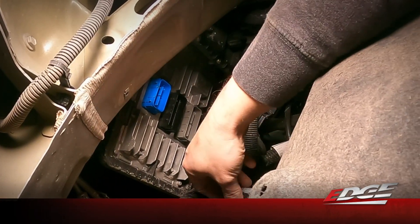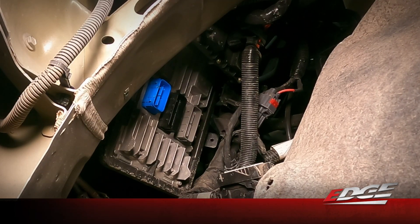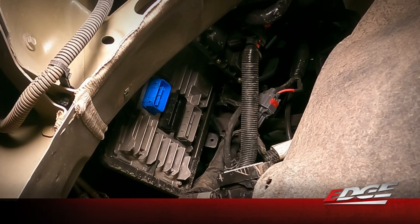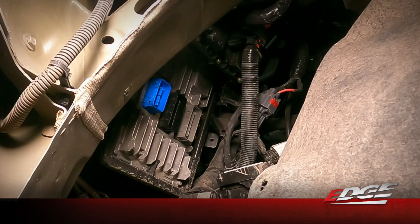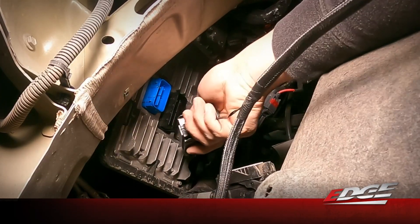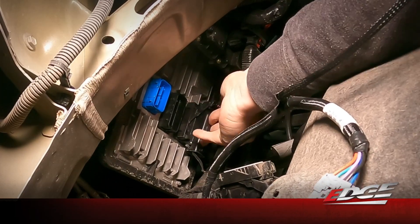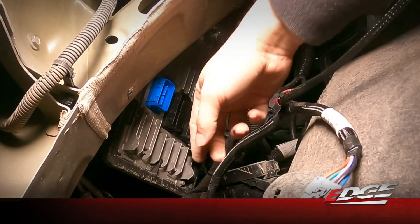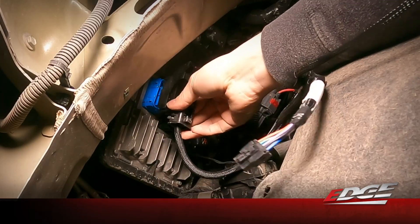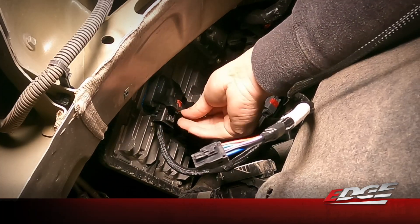We've got all three connectors unhooked. The left is blue, there's a middle black connector, and there's a gray on the inside. Taking our ECM unlock harness, we'll go ahead and connect the gray one to the far connector — slide it on all the way and slide that lock down until it clicks. We are not going to close the red keeper because we'll only have this installed for a couple of minutes. Then take the blue connector and connect it to the blue on the ECM, slide that lever lock down. Now we can go over and connect to our battery.